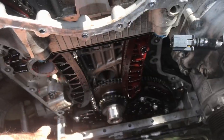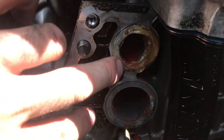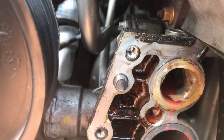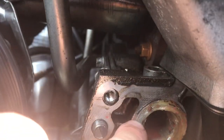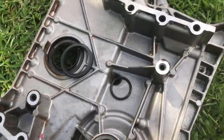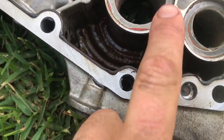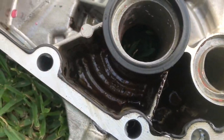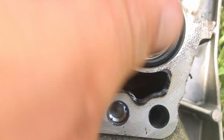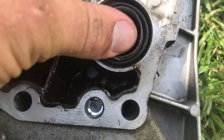There are also a ton of bolts down the front, and that eventually gives you access to the water pump holes. You can see all the silicone around this one — that was where our problem was. The reason I can tell it's definitely the source is you can see all this oil buildup, all this sludge. This is oil mixed with water coming out of here into there and then dropping down. Everywhere else on this timing cover is clean as a whistle except right where these two seals are. This one has swelled way too big, and although the other one fits, it leaks like a sieve.